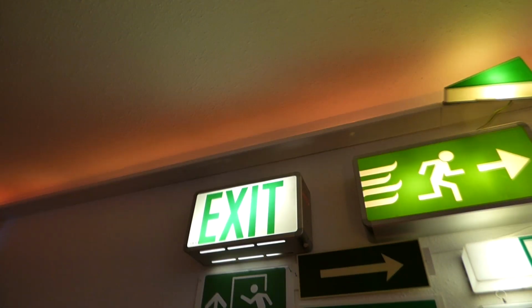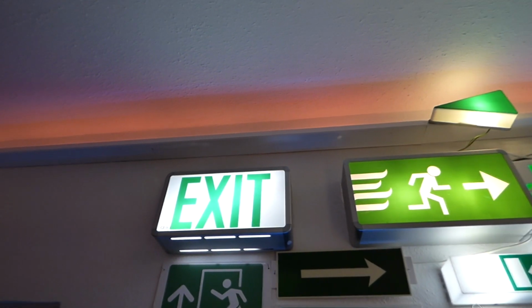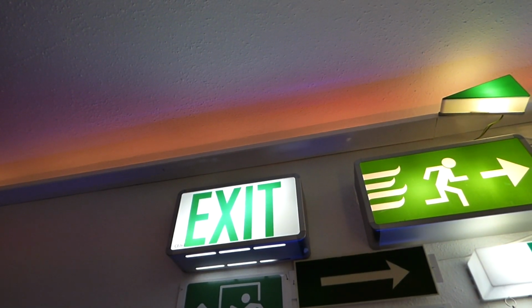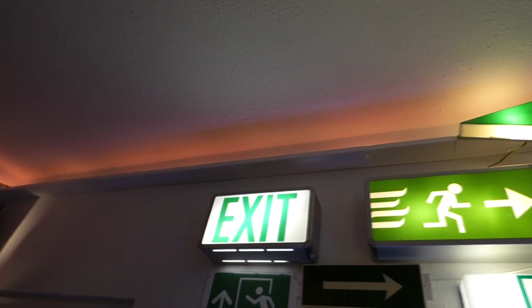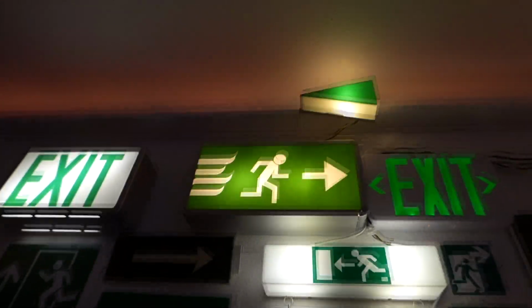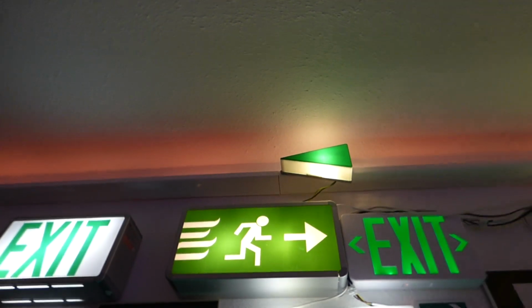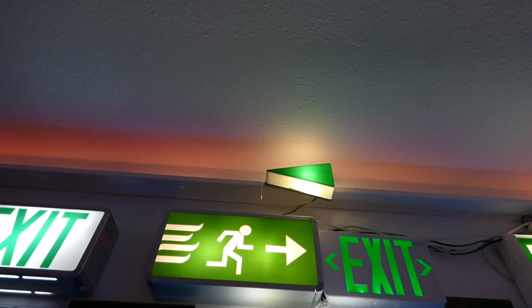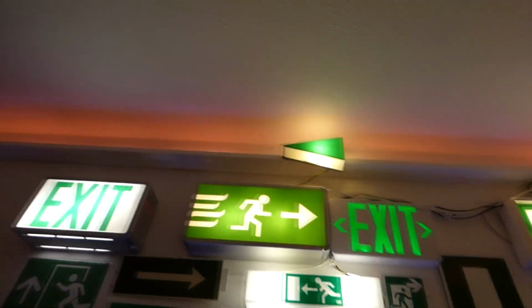And by the way, this one used to have a fluorescent, but the controller was completely burned, like it was overheating for months, so the battery was also leaking, so I basically completely stripped out all the electrics because the ballast was also kind of blown up, and I just put an LED inside of it. Those ones just had two light bulbs, but I replaced them with LEDs because that doesn't put as much thermal stress onto the plastic material, and it doesn't get yellowish over time, so that's why I put LEDs into those.